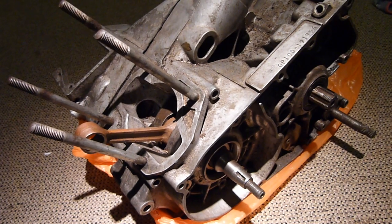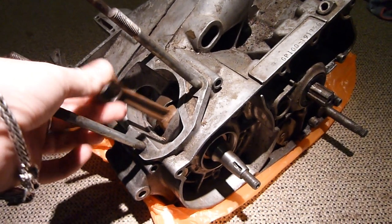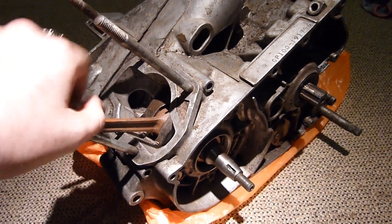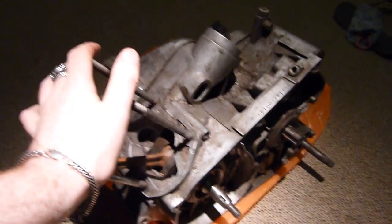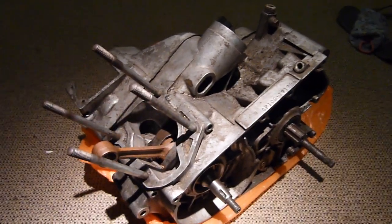If that's the case it'll all go back together pretty well. If not, bearings aren't that much, only a couple of quid. I'll try it this way, and if it doesn't work I'll get some new bearings and seals. The good news is I don't have to split the bloody crank and sort out putting in a new big end, which is always good. I've got enough parts to do it with and I guarantee I'll have a running engine very soon.